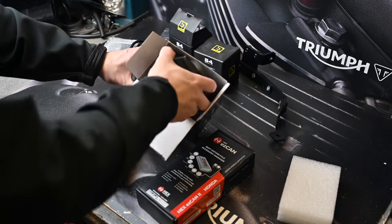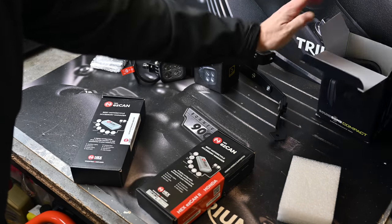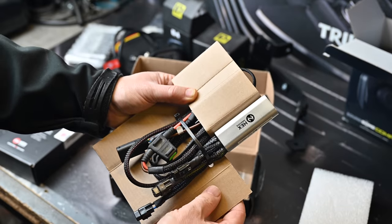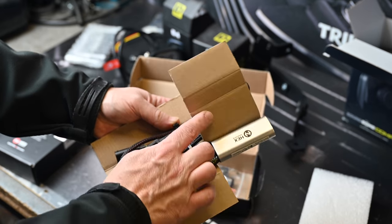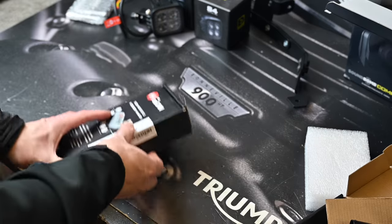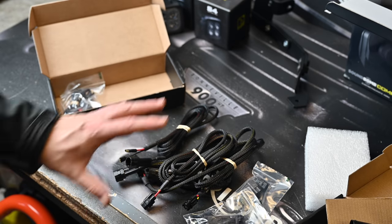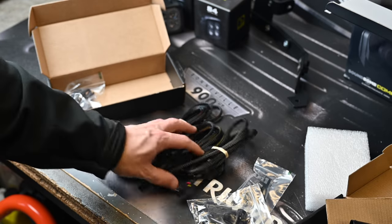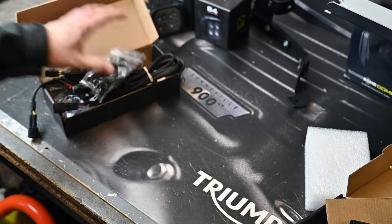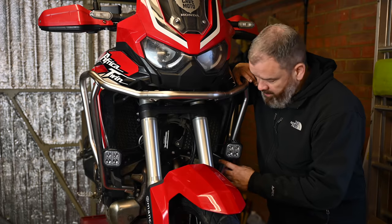There's a Soundbomb compact - although it doesn't necessarily look that compact, the noise it makes for its size is quite impressive. So that Soundbomb, along with these lights, all wire in to the EasyCAN. This plugs in essentially inline on the bike's wiring with all your various outputs, and that allows you to control everything easily. You can set it up with a computer and then control it through the bike's controls. There's an accessory kit which has got more connections and extended cables depending on where you want to fit it. It looks rather complicated but I'll try to go through it and make it simple.